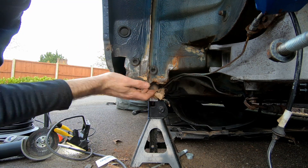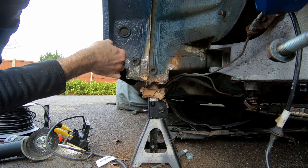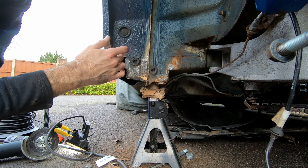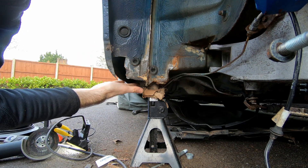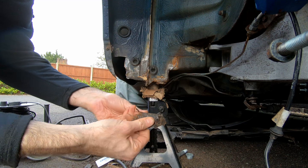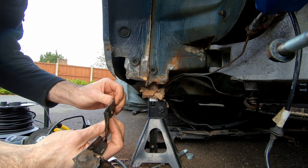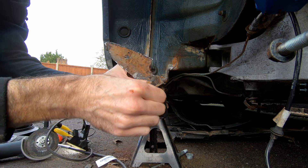The plastic panel that was here to protect from stone chips, mud or whatever — the way one of the previous owners used to drive this thing ended up collecting a ton of sand in here. And I reckon that just gradually wore away at this bit of the panel and started letting water in. Because it looks like there was water and mud pooled just around here, and that's what caused this bit of the panel to rust away. But once you get further into the sill, it's solid metal again, which is great. So I've cut out a decent chunk so that when I weld back in, I'm welding into solid metal rather than into this stuff.